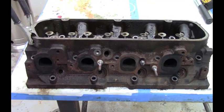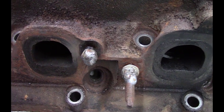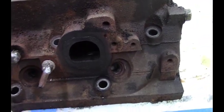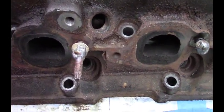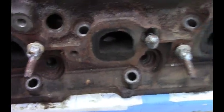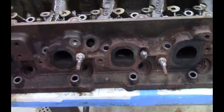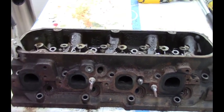Finishing disassembling the cylinder heads — had a couple of the studs break off. If the studs don't come out with the impact wrench when I'm pulling the exhaust manifolds off, I'll just roll a nut on there, clean up the bolt, and weld it. Just because I've got the welder out already, I may as well put it to use and try to save a little bit of time.